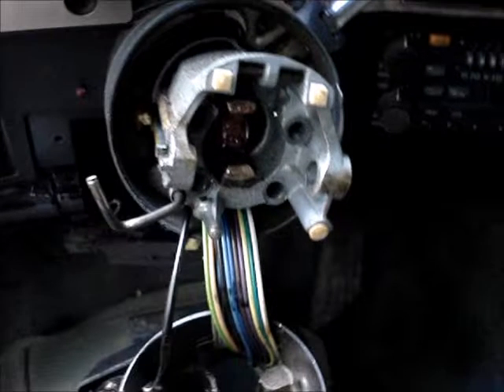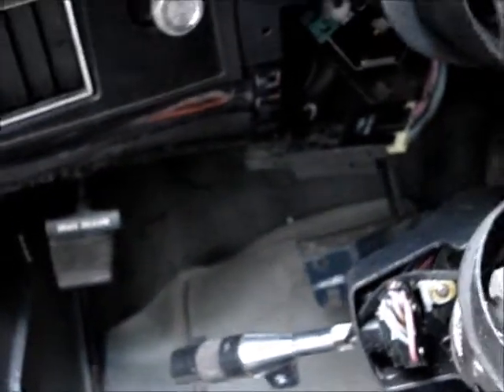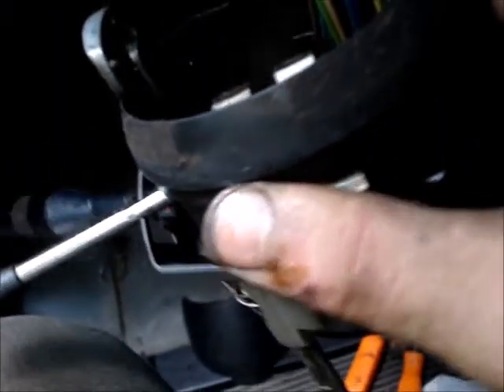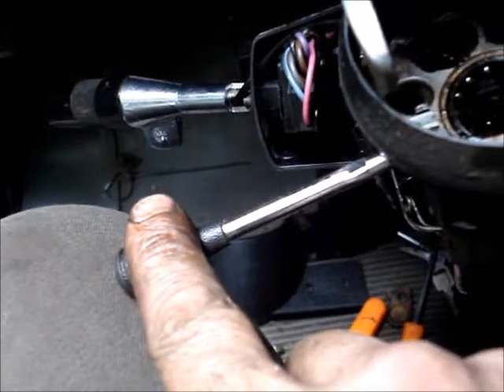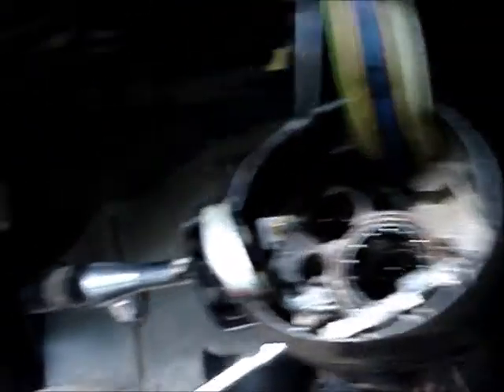And I'm only doing this once. When this sucker goes back together it'll be with some thread locker. I'm in there and these are the bolts that come loose. You gotta watch — I was watching one video and the guy said when he got down to taking this off, this is where he snake and shakes it back and forth. He didn't mention about putting the tilt lever back in. You put your tilt lever back in, you pull it and it releases off of there, and then your steering knuckle thing just kind of works its way out.